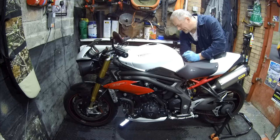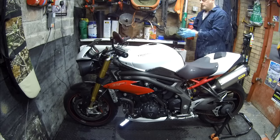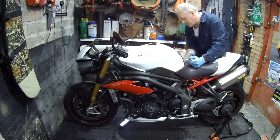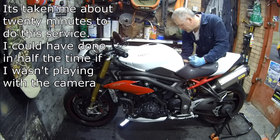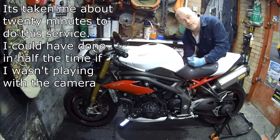Okay. Now normally I'd probably let it settle for a little bit longer just to make sure the level's good, but to save time, we'll have a look now. Remember, wipe your dipstick clean. Okay, so again, now we're about halfway up. I'll let that settle a little bit longer and I'll check it again later. But that pretty much is an oil and filter change, which is known as your minor service at your dealership.